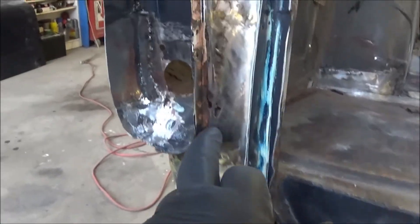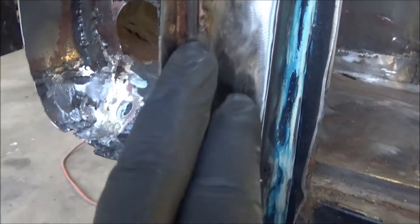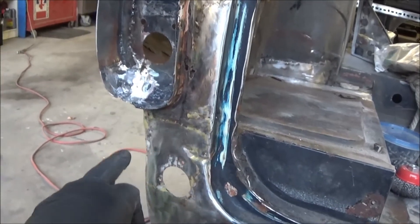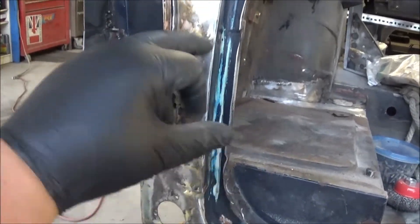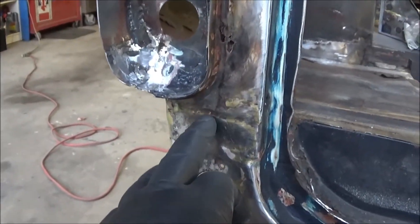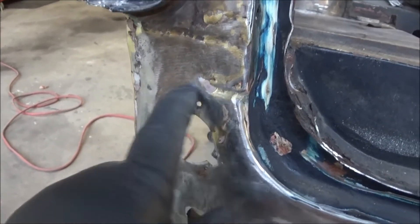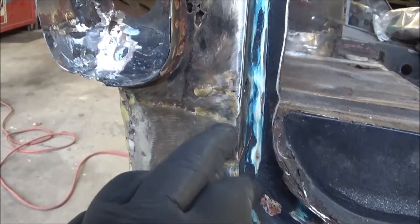Here's a little bit of what I'm dealing with on this rear end. I do have some rust repairs to make here — you can see some perforations along here, so that's got to be fixed. As mentioned, there are a couple of cut lines in here, so the valence has basically a center section to it, top and bottom. I believe that section ends here, and you can see some brazing, so I'd say that's pretty close to where it's supposed to end for the top section. I believe the bottom should end lower, probably around here — I'm going to have to check some photos.